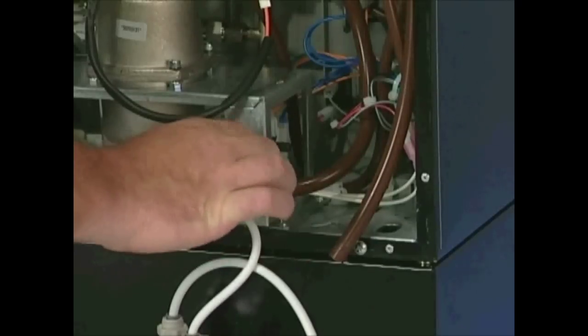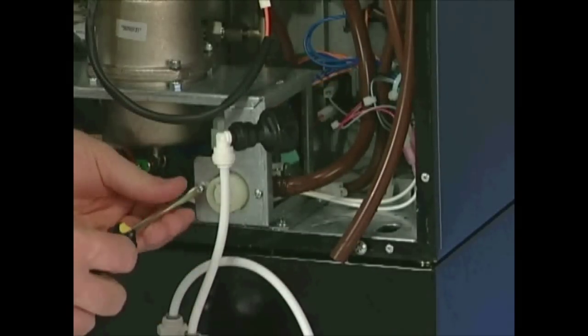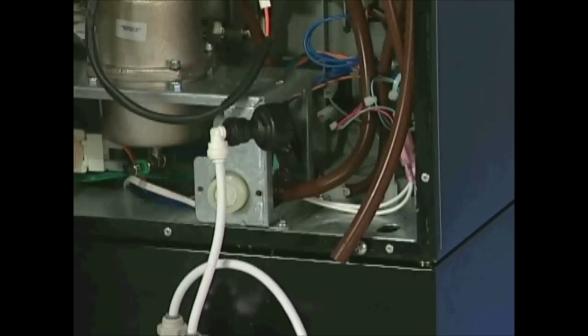This is accomplished by first removing the top hose going into the inlet valve, next removing the two mounting screws and shaking the valve. This will reset the magnetic switch inside the valve and the circuit will then again be complete.